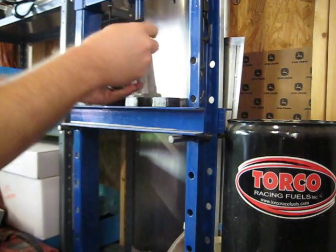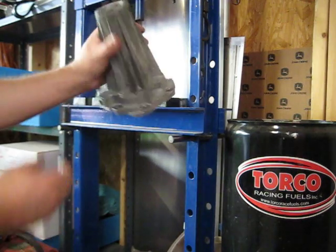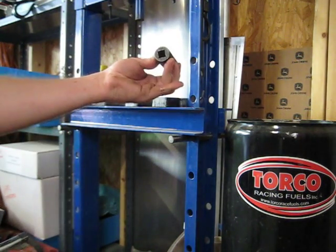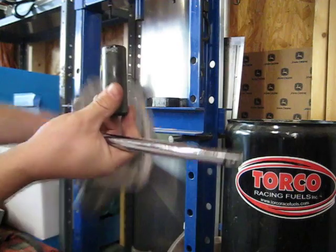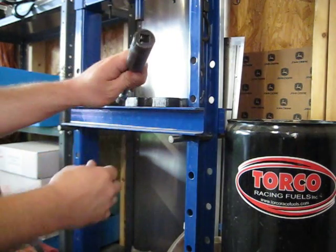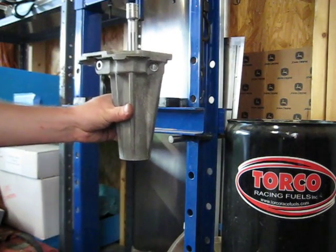There are a couple things you want to keep an eye on: you have a spring and then you have your inner bearing — we'll get to taking that off here soon. Now all that's left inside the housing is the nose bearing and the seal. What I like to do is take the largest socket that I can get down in there, because you're going to have your inner bearing bore to fight against. I find that a 21mm is about the biggest, with a long extension. A trick my dad showed me — instead of the traditional way of doing it — is you put it inside so you've got a nice flat surface to work against.